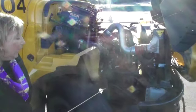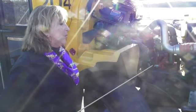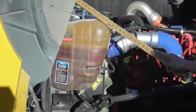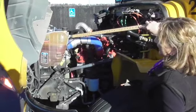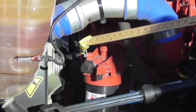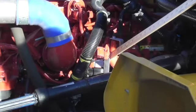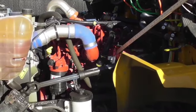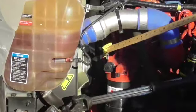We are going to walk to the other side of the bus. As I walk around, I will state that everything I just checked on this side I will also check on the other side, but for the purpose of today's test I am only going to show you what's different on the other side. The first thing on this side is our coolant reservoir — securely mounted with all bolts in place, the hose is not leaking, doesn't appear to be dry rotted, and my wire is not arcing. This is my oil dipstick to check the oil or the transmission fluid, checked the same way by pull, wipe, re-stick, check — transmission checked while running, oil checked while off.